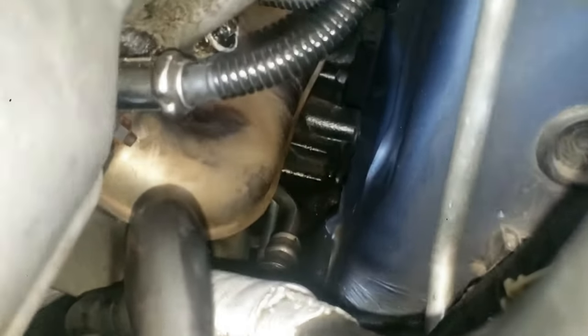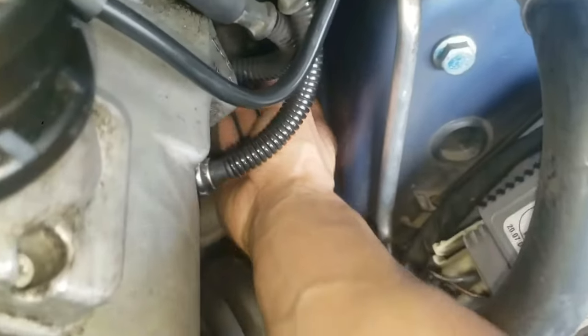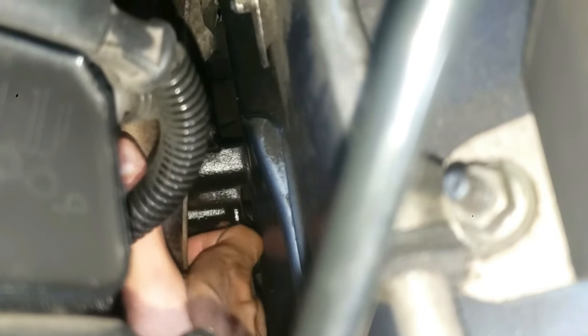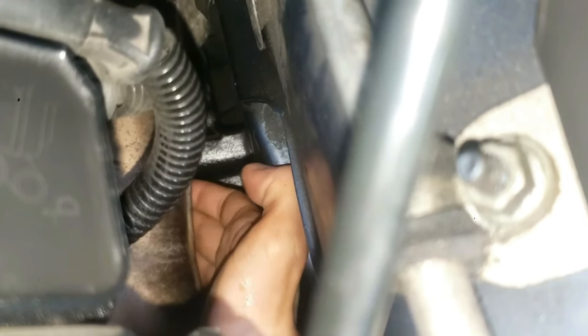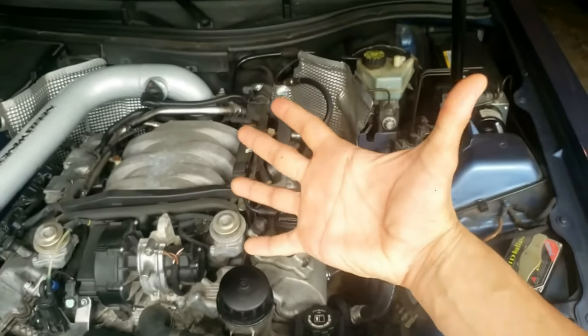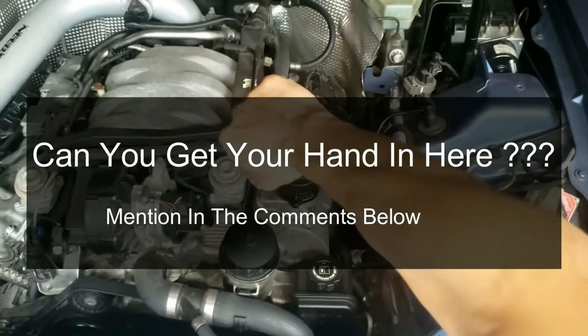To get to it, you see this black engine motor block or bracket. You have to slide your arm under the engine exhaust manifold and touch the black hard engine motor bracket piece. My forearm is moving under the spark plugs adjacent to the engine, and my hand is touching the exhaust manifold. About one to two inches to the left is the nut that needs to be removed counterclockwise — you're going completely by feel. This may be hard with large hands, as mine are a medium size but my forearm is big. The smaller your hands or forearms, the easier this will be.